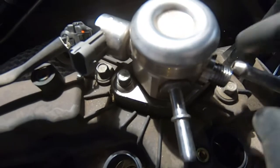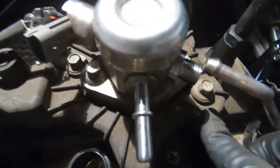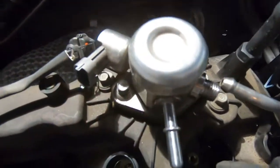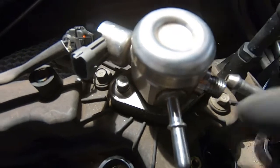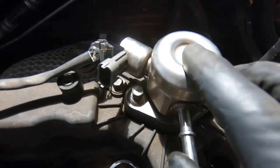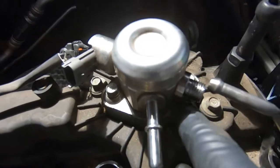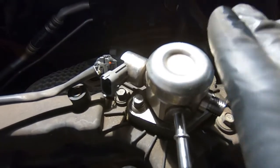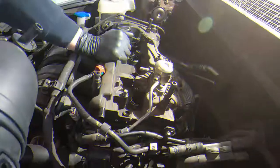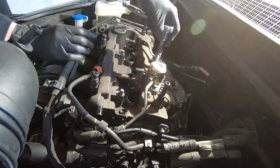The only thing left is to get these two 10mms going into the high pressure fuel pump out, along with another 10mm right here. For the high pressure fuel pump bolts, you do have to back these out slowly at about the same pace — a little turn on this one, little turn on the other, going back and forth evenly. This is spring-loaded and has pressure, so you can break bolts or damage something if you're not careful.